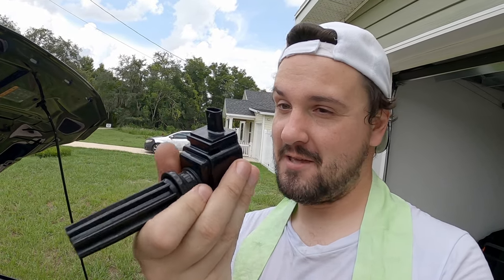Since my last test was spark plugs — trying to get away with a bigger gap because I'm running these high output coils — it didn't really end the way I thought. So I thought maybe I should try something a little different. That's when I thought about side gapping the spark plug.